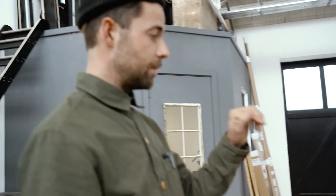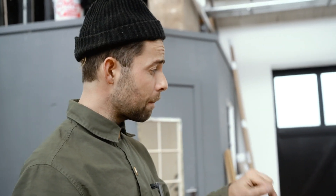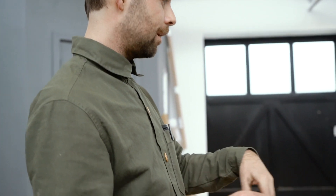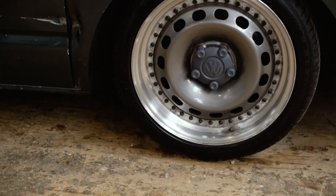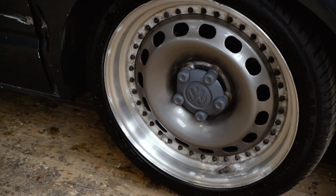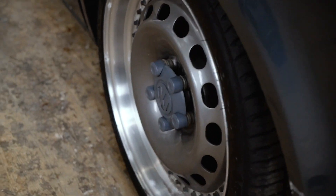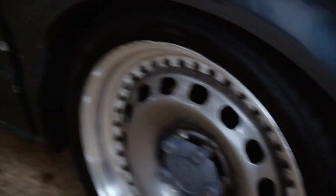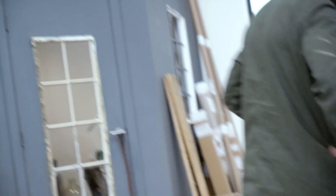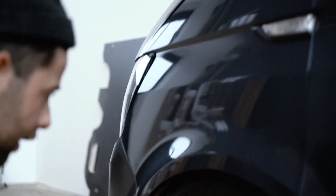This is really nerdy stuff. It's BBS three-piece split rim hardware mated with a Volkswagen Caddy wheel — 17-inch Caddy wheel, steel cut out, then re-welded, then re-drilled, then mated with the hardware. It's stupid really, but it's pretty badass. It's a Caddy fitment and then it's got VW T5 5x120 adapters to make it all work, and then it's got little tires.